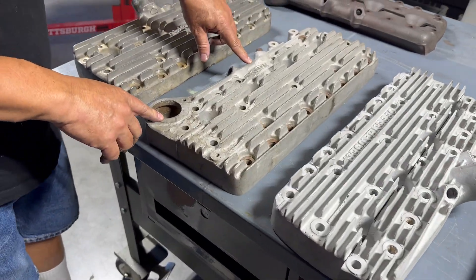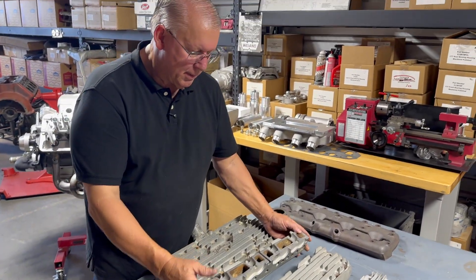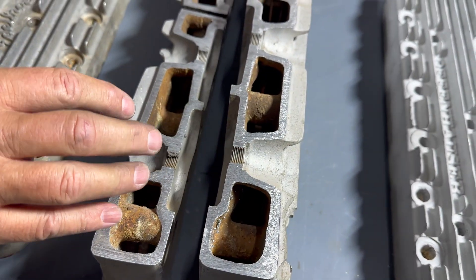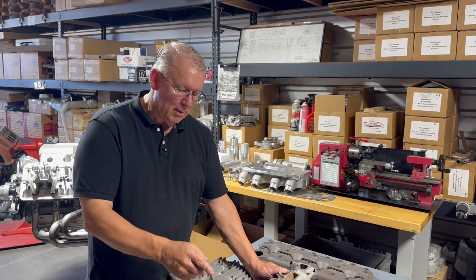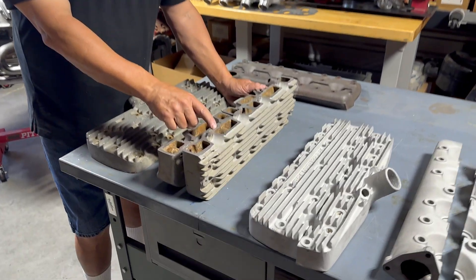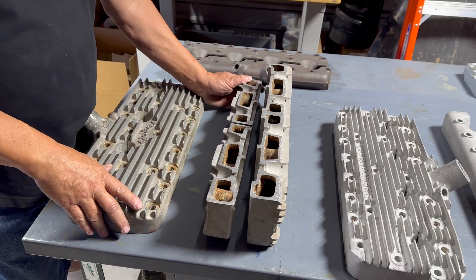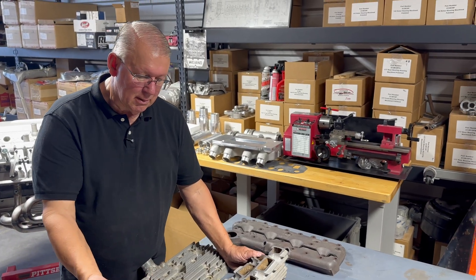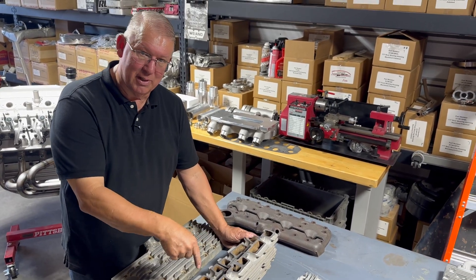On the other end of the spectrum, this is a Fenton 8BA-style head — 24-stud, late-model head. I think it's probably the thinnest of them all. When you look at the chamber thickness here, if I was taking a Fenton head and trying to machine the chamber deeper for a blower application, you could get into trouble pretty quickly — you're taking away from this thickness, which is already relatively thin compared to the other examples. You can see that without even measuring it, just eyeballing it. So relatively thin. Is it still thick enough for a supercharger? I don't know, but I'd feel better with the Offenhauser version than the Fenton version for a supercharger.